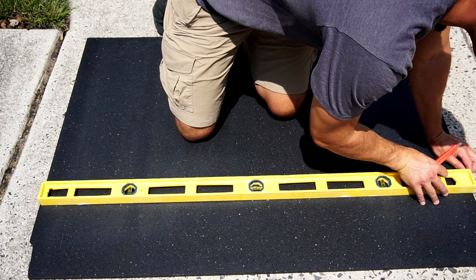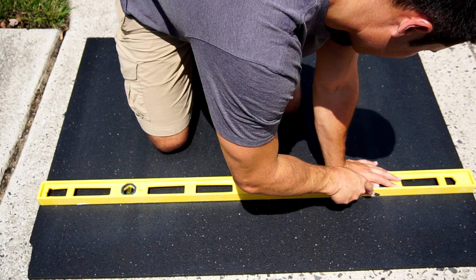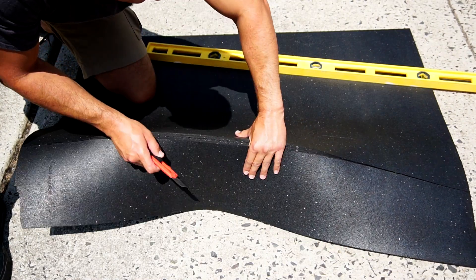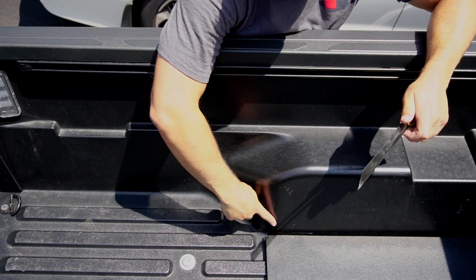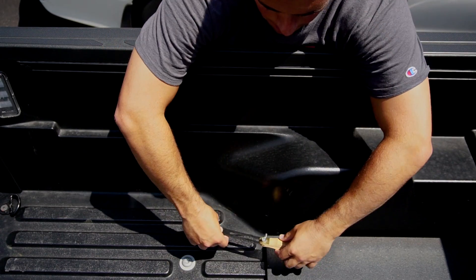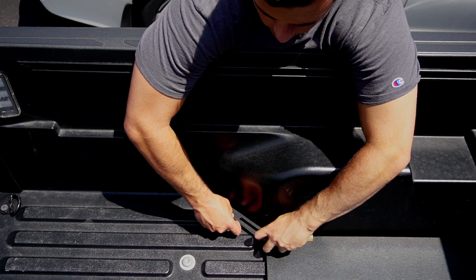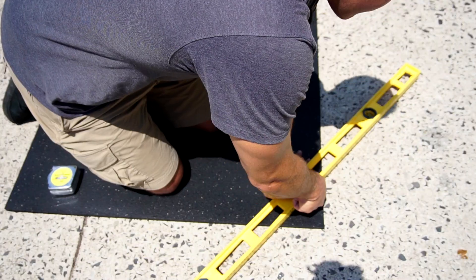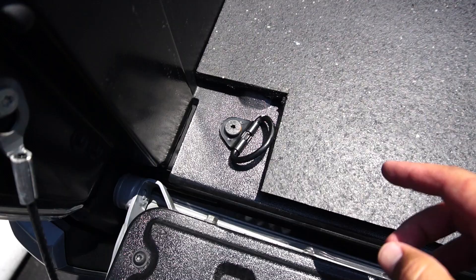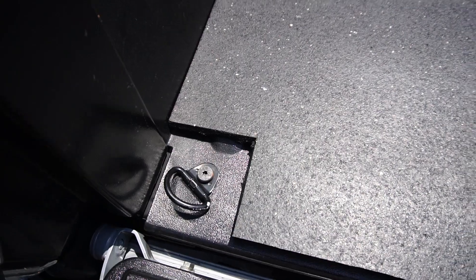The first thing we're going to do is measure and cut these to size. To get the correct angle for the wheel well, I'm just going to be using this tool — I don't even know what it's called. Put it right there on the angle and it'll give you the perfect angle, so there's no guessing games. If you've got these anchors in your bed, you'll go 4½ inches over, 4½ inches down or up.